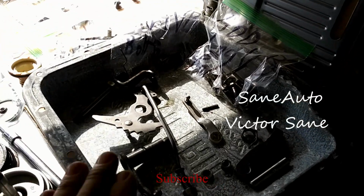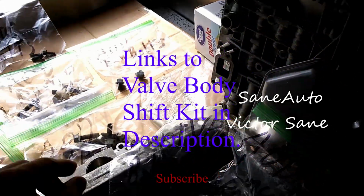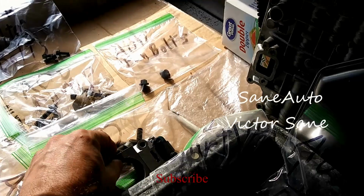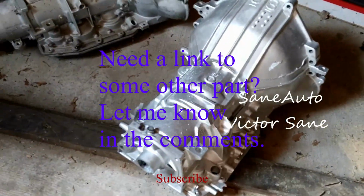First thing you're going to take off is the pan, the filter, the valve body, the tail housing, and if it's an AOD, the governor. If it's not an AOD, if it's a 4R70W or a 4R75W, you won't have a governor.